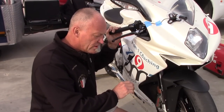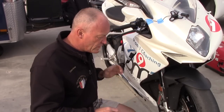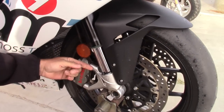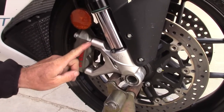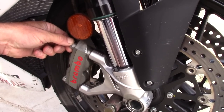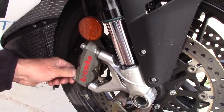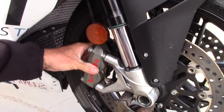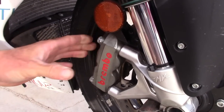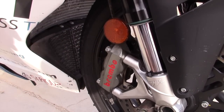When you've put the wheel back on and the axles are all done, what is so important — whether these calipers sit on dowel pins or sit flat face to face — is to have all four bolts just finger tight. That way it allows the caliper to flex and move into position, so the purpose now is to get this caliper perfectly aligned with the rotor.